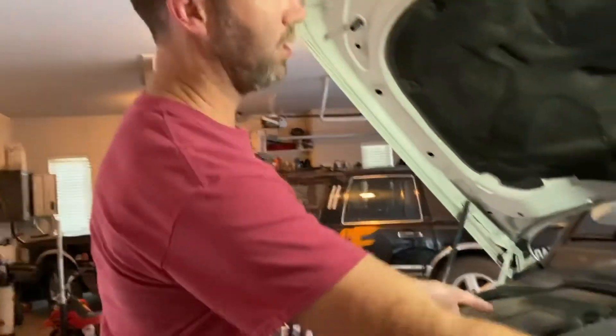After I checked that, I swapped my mass airflow sensors between my car and her car — they're the same ones. The check engine light came back on after I reset it. So I changed the upstream O2 sensors; it didn't change the way the car ran and the check engine light came on again. So I started to investigate for air leaks in the top of the engine.